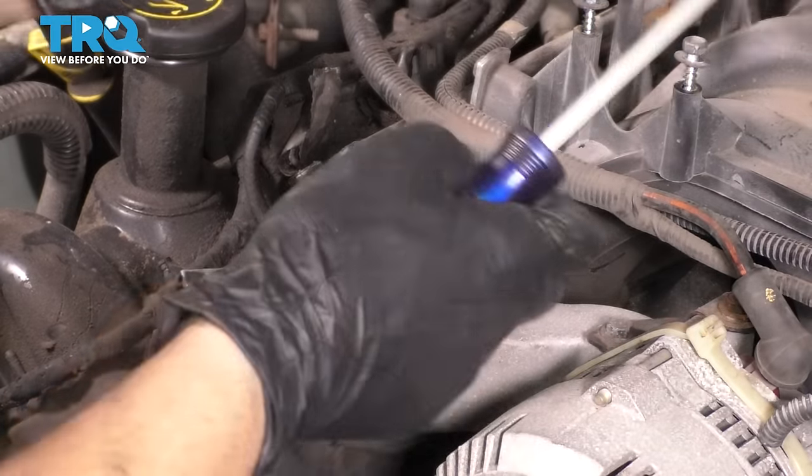Okay, they're all broken free completely. So now I'm gonna get my air ratchet with a 13 millimeter and drive them all out. They're all loose. You can even take them out by hand, but I need something a little faster. All right, I changed my mind. I'm just gonna use my 3/8 impact. They're all loose anyway, so it should be fine.